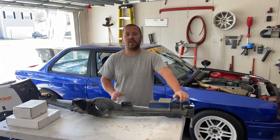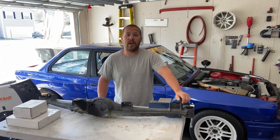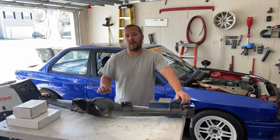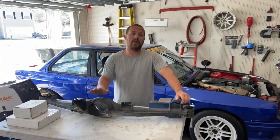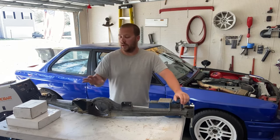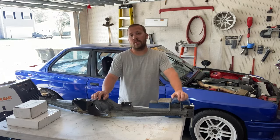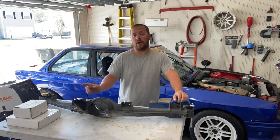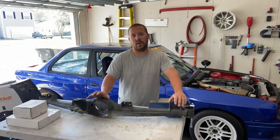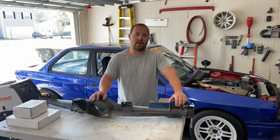Having the camber as well as the skinny tires I've been running have allowed me to keep wheel speed up and hang with some of these other guys, so now that we're actually making some power, we need to try and get as much grip as possible. So what we're going to do is weld on not only reinforcements to strengthen the subframe and the trailing arms, but I got some camber and toe adjustment tabs from Garagistic that I'm going to weld onto the subframe so I can actually adjust my trailing arm and set my alignment properly.